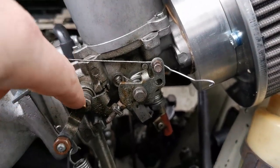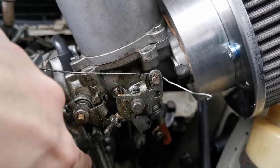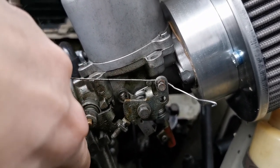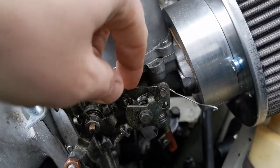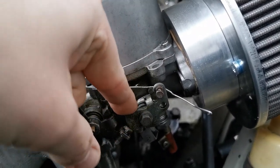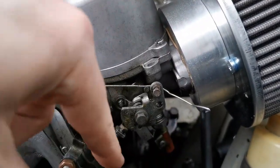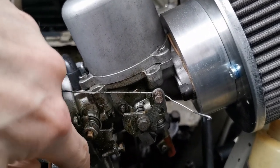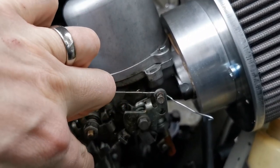Here's that rub point I was talking about. If you see here, this is the accelerator cable coming in - if I just push this, you can see when you depress the accelerator pedal inside it gives us that gap. This here is what's controlling the jet, and this is the cable coming in from the choke. When you pull this cable tight, the choke pushes out and it pulls the jet down on the carb, getting more fuel through into the system. So what I'm doing when I press the accelerator inside is opening this gap, which means this piece here when you pull the choke can move without friction.